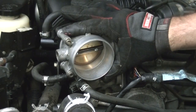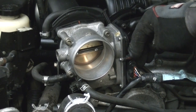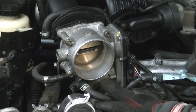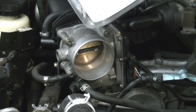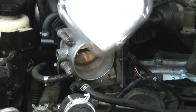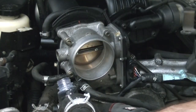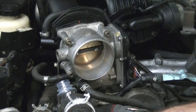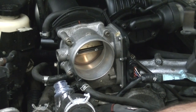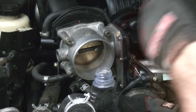We're now at the actuator. We need to remove these two bottom hoses and this one electrical connector. These two hoses are actually filled with antifreeze, so what you want to do is grab a container — I have this old window cleaning solution bottle here. I'm going to slide this bottle down right underneath, open it up, and let it drain into the bottle. The other option, which I really do not want to do, is empty the system, and that seems like a huge pain for something this small. Hopefully I don't run out of space, and then we'll be able to remove both hoses and take the actuator off.